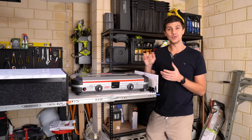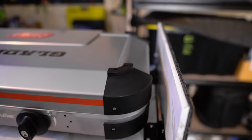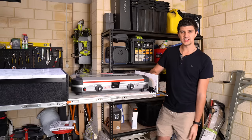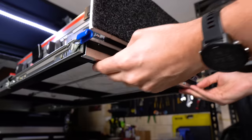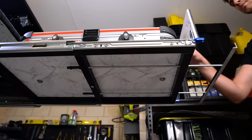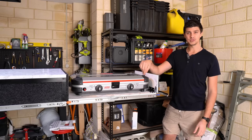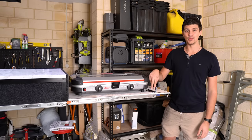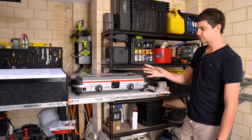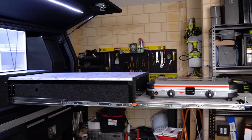Probably the biggest problem I had with mounting this stove here was that the gas inlet is on the side here. The solution I've come up with is to put this panel on a bit of a hinge system. So this is essentially just a couple of steel rods that run through the frame of the cooker underneath here. I've added some stoppers so they can't come out past that point. I then put some aluminium angle on the front to give it a bit of structure. And the tabletop just kind of folds down and rests on that support. And being steel rods, it's actually surprisingly strong. And I reckon when I'm cooking, that's going to be such a valuable bit of space to have, whether it's just resting a drink or a bottle of oil.